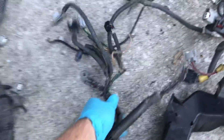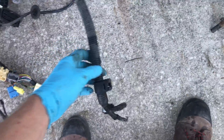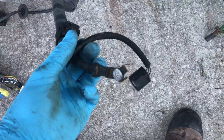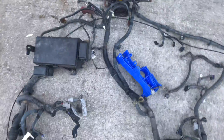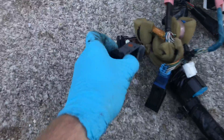There's another harness that comes up the middle as part of this, going into the starter, the air injection pump, and the knock sensors all underneath the intake. You've got to remove the intake - it's not that hard, but the starter's in a bad place back there, really tight by the firewall. Then there's another connector along the driver's side of the engine that hooks up to the AC compressor, some sensors on the front, and the alternator.